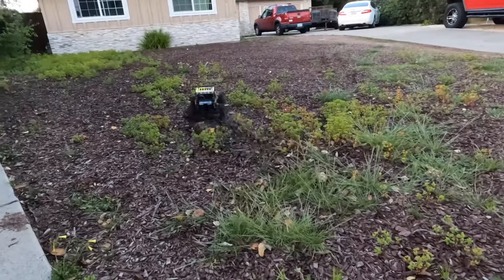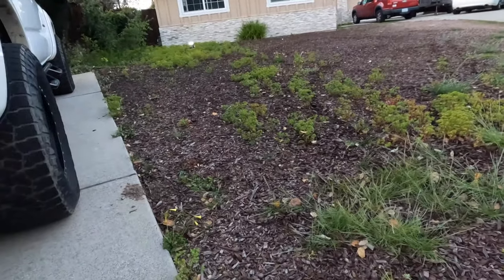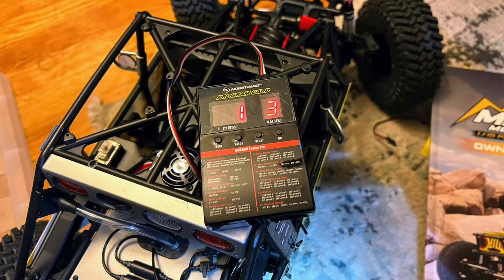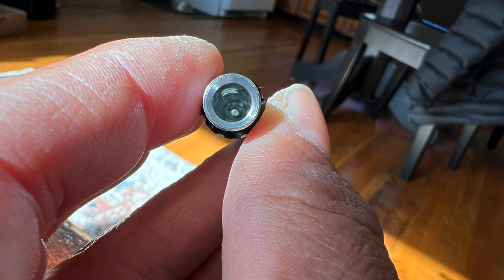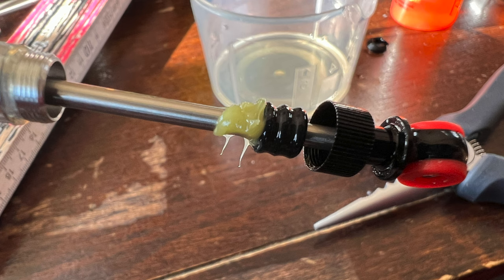The punch wasn't as great as I expected from a brushless motor, so we'll fix those little issues. The motor is programmed with a Hobbywing card — just plug into the ESC where the fan was plugged in and follow the table in the manual. I took out all drag brake — zero percent — put the punch all the way to max, increased the timing, and made sure I was on forward brake reverse. For the shocks, I opened them up — only got the rears done. There was no oil whatsoever, though they were a little moist so there may have been some leaking. I put in some green slime and 50-weight oil on the rears for the next shakedown ride.